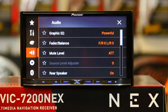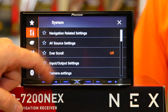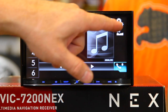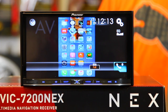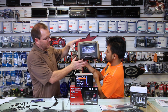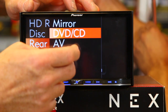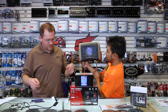First things first: come over here and click the gears, go to Tools, go to Input/Output Settings. Come over here where it says AV Input and go ahead and click it to Source. What that's going to do is when you click the drop-down, it's going to give you a new AV source. As you can see, it's now mirroring my phone. We have our rear monitor playing a DVD, but we're going to switch it to our new AV — come over here, click Rear, and switch it to AV. Now you can see it's mirroring my phone.